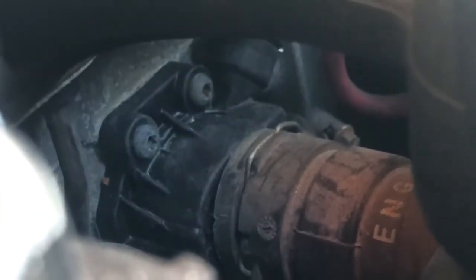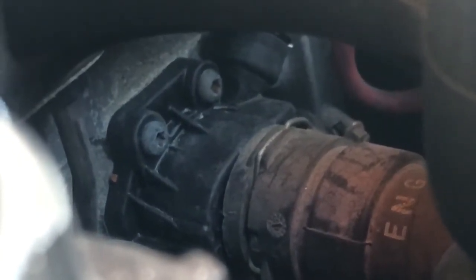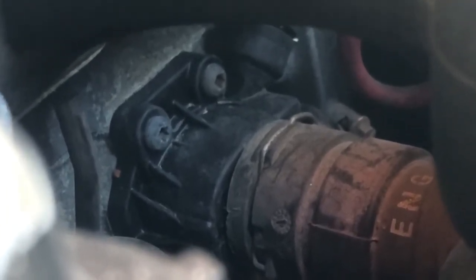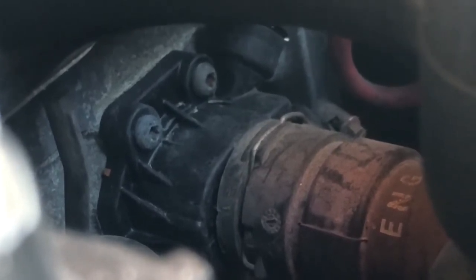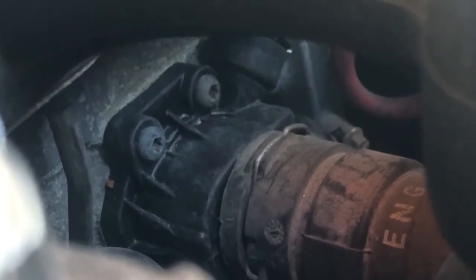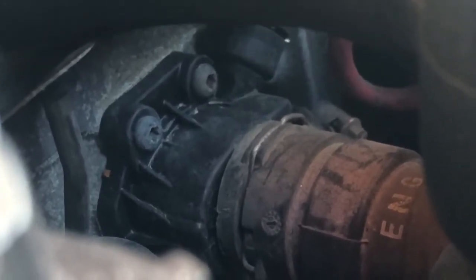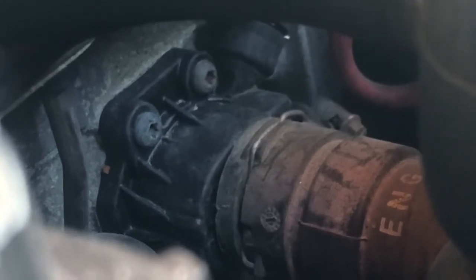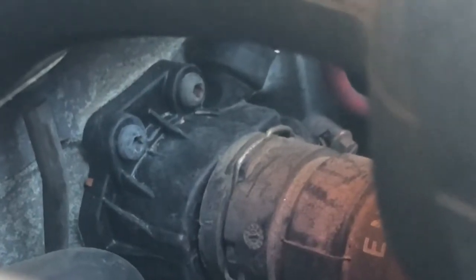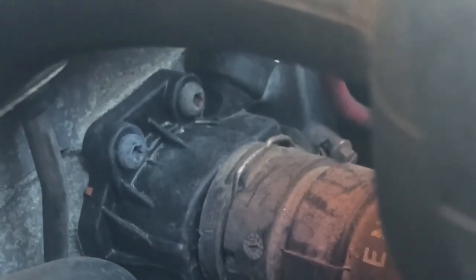For what it's worth, when I took my thermostat out the innards kind of fell apart. At 255,000 kilometers I would say replace the thermostat in that range of mileage, because almost the entire thermostat assembly is made of this strange plastic material that does suffer abuse from heat. It was due for a change, and it's super simple to replace. I went with an original Volvo part — it was expensive but not terribly so.